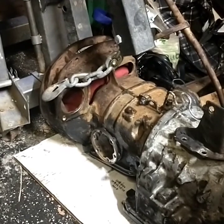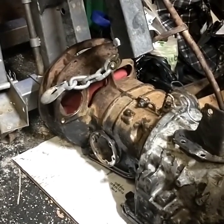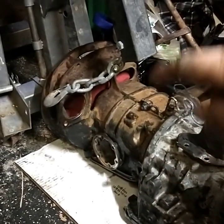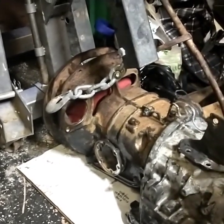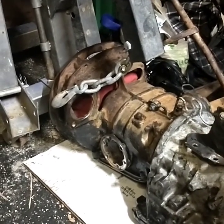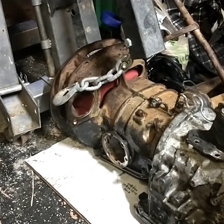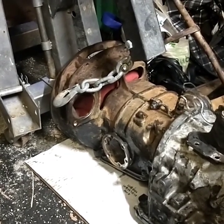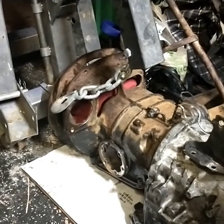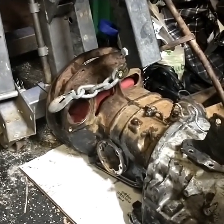Once I get the torque converter seal and the side cover seals, this thing is ready to go in. It'll be a few weeks before I have time to do that because we have to pull the motor and transmission out. This was not as bad a job as I thought it was going to be. The main thing is lifting that transmission off — you're going to need help. We had to lift it up and tap it to make it come off, and it's just really too heavy for one guy. The hoist was the way to go. Anyway boys and girls, don't forget to like and subscribe — let's get out there and work on our projects and get these things done.